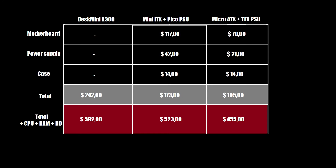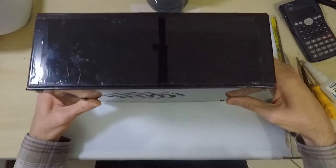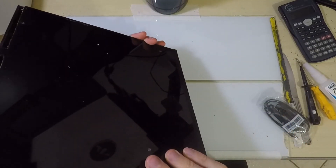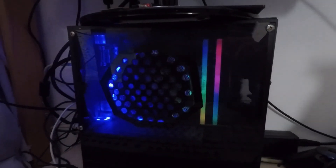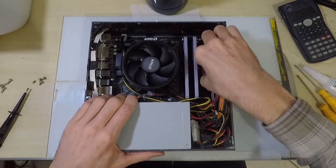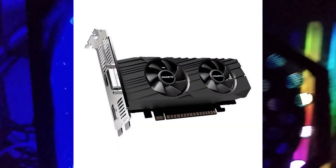Overall I'm very satisfied with the result. It doesn't have the same refinement as a Desk Mini type mini PC, but it is already much more compact than a conventional case, and I've been using it for over a year with the weight of the monitor on top of it without any problems. It took me about two days to build, but I wasn't working on it full time and didn't have the right tools. Someone with more experience and better tools could do it in a few hours or less. For a more refined result, laser-cutting the parts would give much better edge finishing and faster assembly. Another interesting idea is to use a Pico PSU and use the freed space for a low-profile GPU, though in today's market GPU prices make that less appealing.